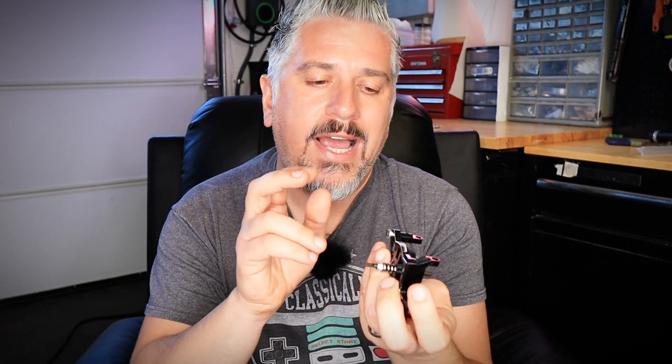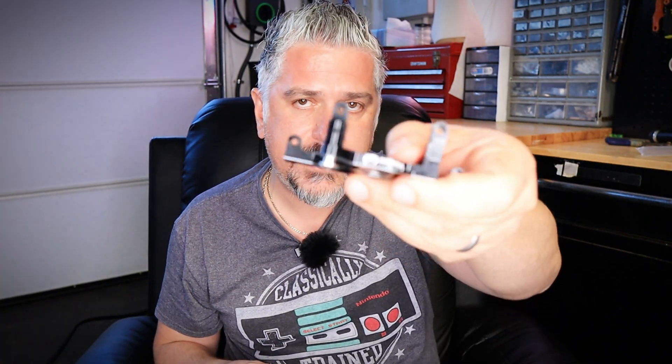When this thing is spinning — look at this, spins like butter. The bearing gives it a lot more support, and this support translates to less parts that are actually moving depending on how you're driving, whether you're bashing, racing, or crashing. This thing basically stays put because you have a much wider and bigger bearing, and then you have the motor mount that doesn't flex. If you combine both the Cobra Racing motor mount with the Cobra Racing spur assembly, you're going to have a situation where it's very very unlikely that you're ever going to strip one of these gears.